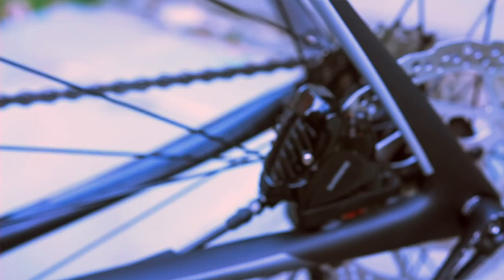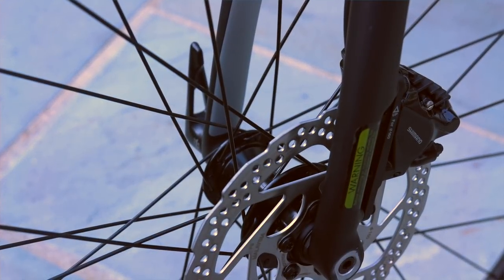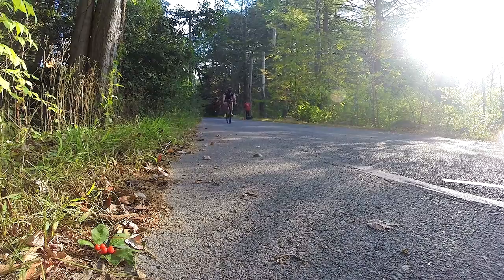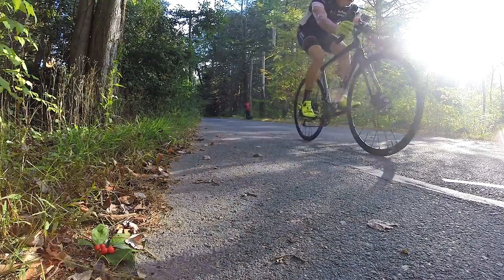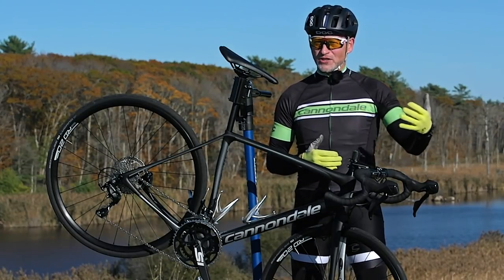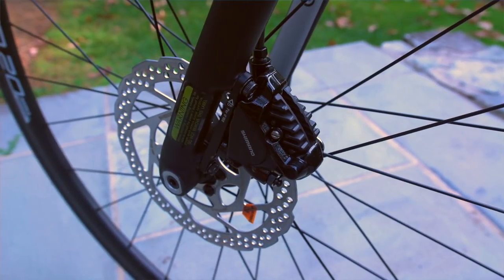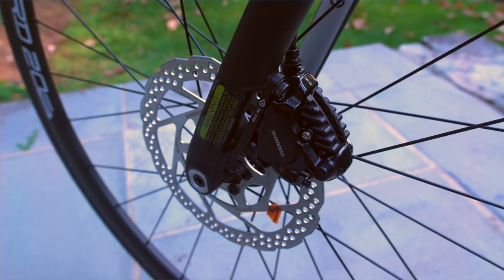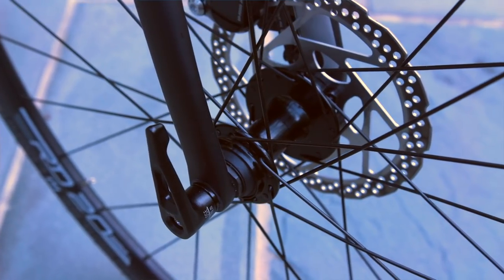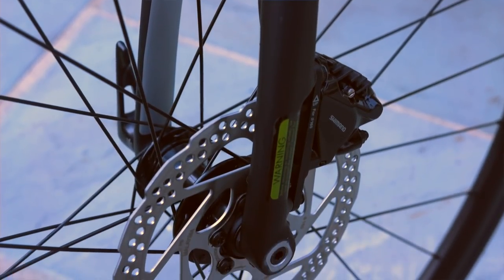One of the things I really like about this bike is the braking system. The hydraulic disc brakes have a very light feel but a very powerful grab, so you're able to slow down quickly in any conditions — wet or dry. The 2017 had post-mount brakes; this has direct mount, which is a little cleaner and a little lower weight. It also has through axles, which help stiffen the frame and eliminate some rubbing you might hear in the disc brake.